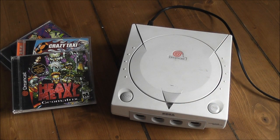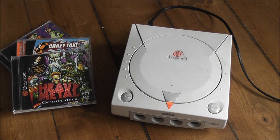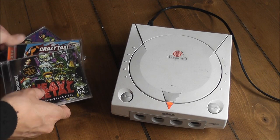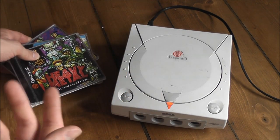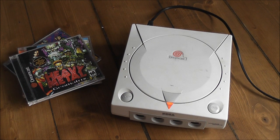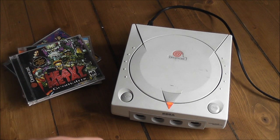It's all reassembled now - I'll fire it up and make sure it all works. And yeah, it works fine. So I can now play my NTSC-U games on my NTSC-U console without the need for an external bulky step-up or step-down converter. You can do this whatever region you're in - all you do is switch out the power supply unit for whatever region suits you. Very easy to do. Thanks for watching and I'll catch you again soon.